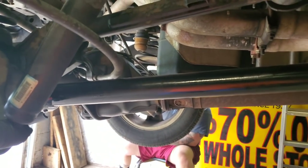All right, putting the tire back on. Lower control arms are both on. Going to put the rotor back on, brake pad, finish up. Everything's fixed. We just finished up — fixed the cross-threaded stud. Took the rotor off, that's all done. I want to thank Dave who let us use his lift at his house — that was a huge help.